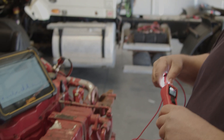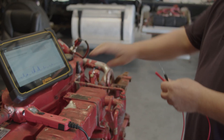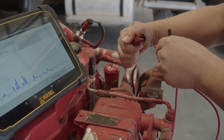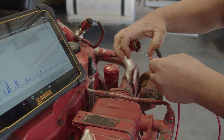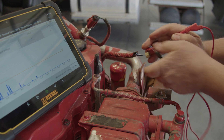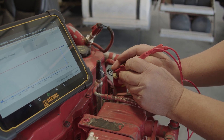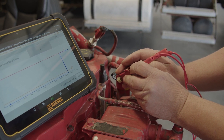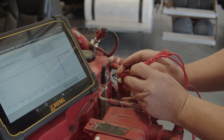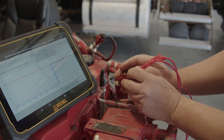It's not a full voltage drop test, but it's at least telling you that the wire is not broken. To do the bypass test, I'm going to take my wire from the Power Probe 3 and jump the 5-volt reference to the signal wire. As you can see, my alarm went off, and I've got close to 5 volts going on that signal wire, as we can see on the scan tool. I've just proved out, without a doubt, 100% accuracy that all the wiring going to this sensor is good — we don't have a wiring problem.